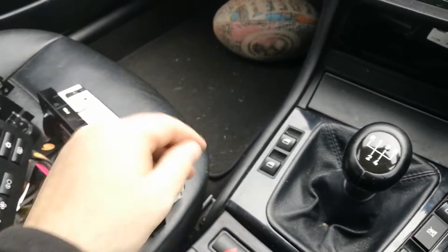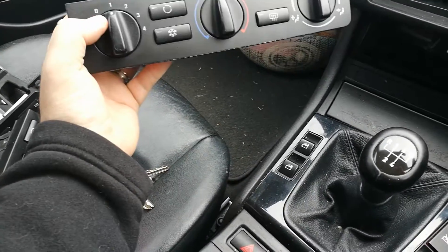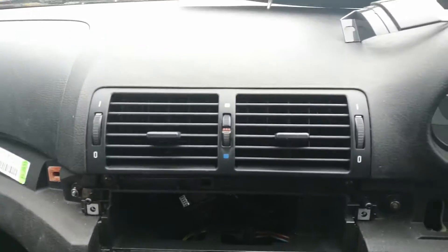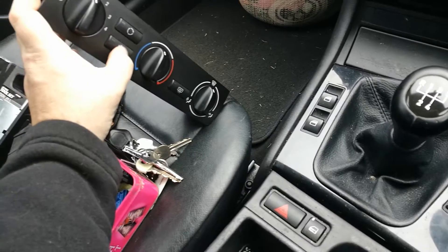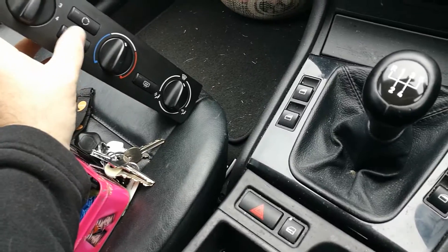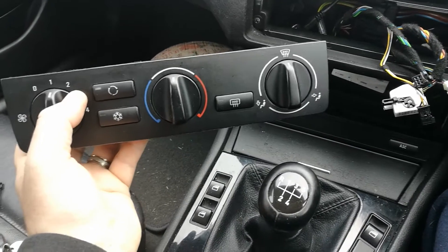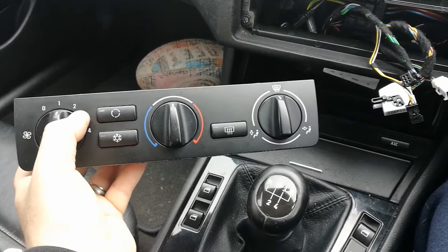As soon as I turned the blowers on - absolutely nothing. I don't know whether the unit is damaged because I wasn't getting anything, I wasn't even getting any sounds from the dashboard. I was trying the buttons, the demist came on, lights came on, things like that. I let the car run for a good 20 minutes so it was nice and hot because the temp bar was on half, and still didn't get anything.